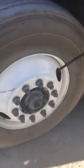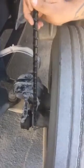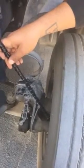Going on to my brake drum. I'm going to be checking through the inside and through the outside, through the ventilation holes. Making sure it's not dented, cracked, broken, or illegally welded. I'm checking the inside for any white powder or black powder — white powder will indicate that the brake is overheated and a fire extinguisher was used; any black powder will indicate that there's metal-to-metal rubbing. I'm also checking for any fluid leaks on the inside — any fluid leaks will indicate that my inner axle seal is busted and needs to be replaced.